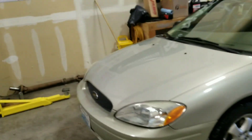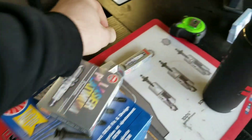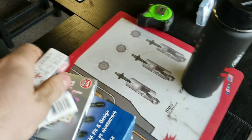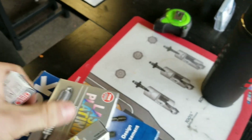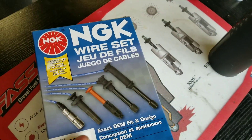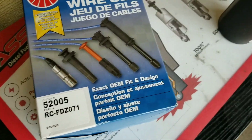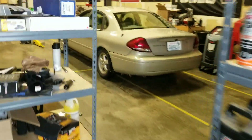Today we've got a 2005 Ford Taurus in the shop. I've got plugs and wires ordered for it — it's got the OEM stuff in it still, probably from 2005. I've got some NGK laser platinums, that's the OEM recommended, and NGK plug wires. I pretty much only put NGK stuff in vehicles.